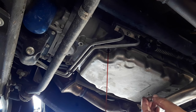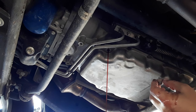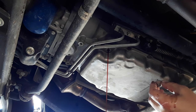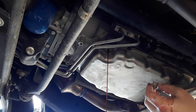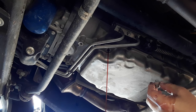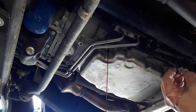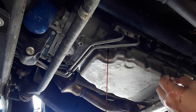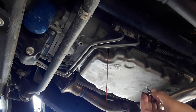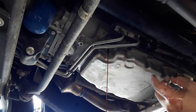It is important on these vehicles that you don't have too much fluid or too little fluid. It is in park and the engine is running. That's important too. Now, if no fluid came out, I would have to pump some in over there on the other side in the hole. And I didn't want to have to do that, and I don't want to have to put all that stuff together whenever the exhaust is hot. So I wanted to make sure it had, if anything, a little bit too much in it so that it would run out the way it's doing.